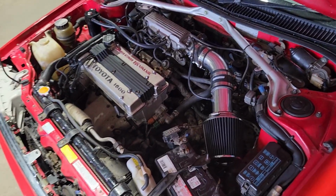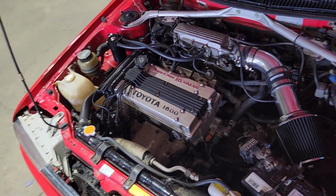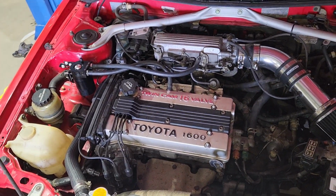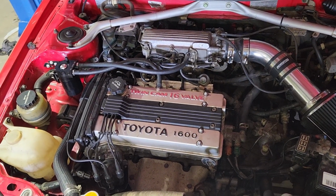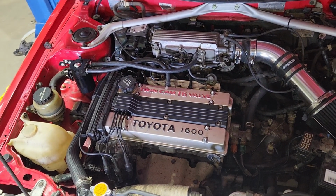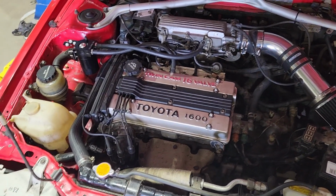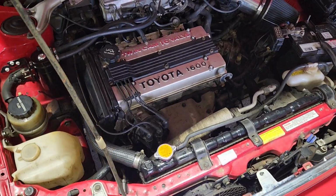In short, the process I used: I left the plugs out, disconnected all the injectors, and just cranked it over on the starter motor until the oil pressure gauge in the car showed pressure. Once that was all good, I knew it was going to be fine, chucked the plugs in, connected the injectors and cranked it, and it started up straight away. No real issues. Timing was a bit out, but a timing light fixed that.